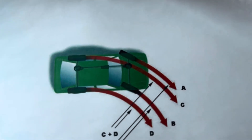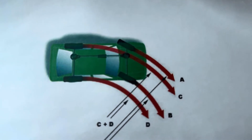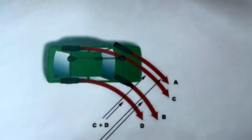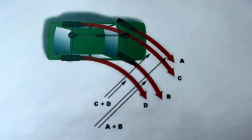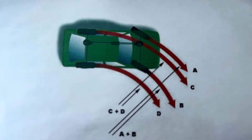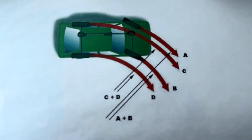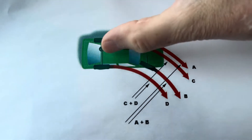This is what your car is doing — what each one of your four tires is doing when you turn a corner. Each one of those lines is going around a slightly different radius of a circle, which means each tire needs to be able to turn at a different rate of speed. That's why you have differentials. Your front differential allows the right and left front wheels to turn at different rates of speed.